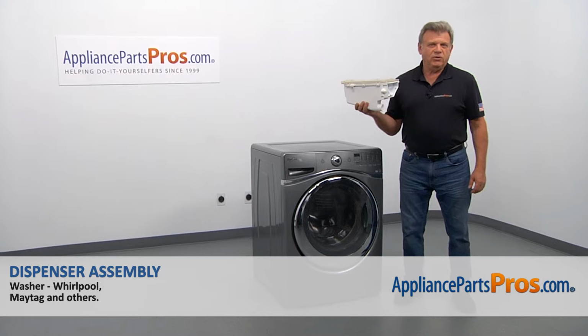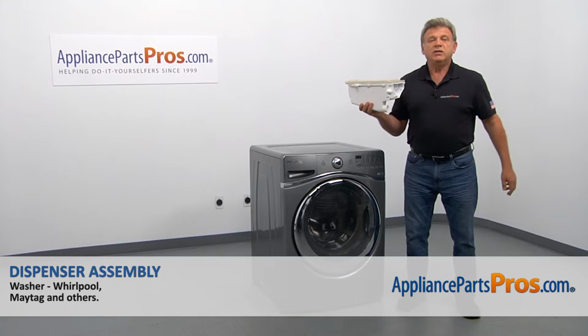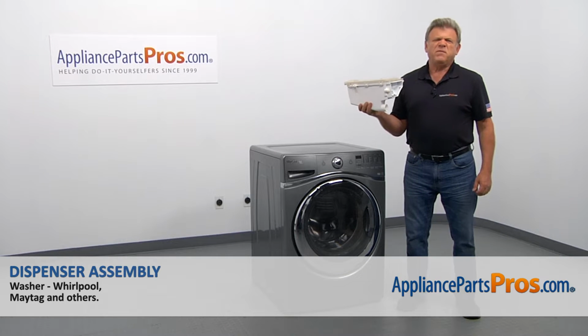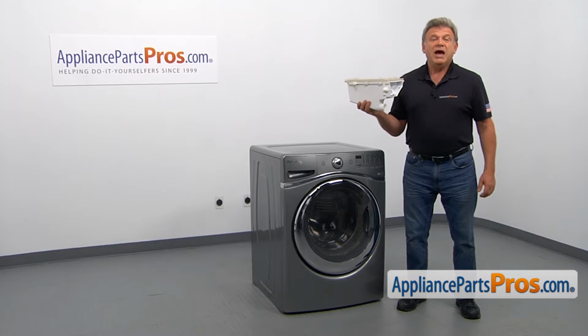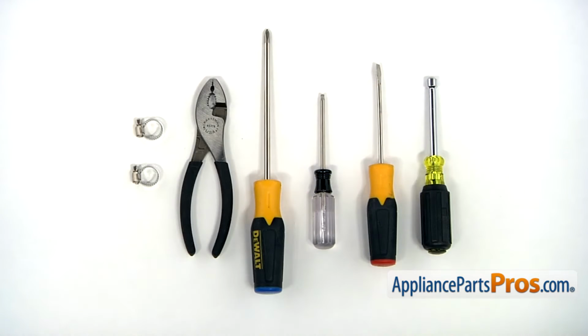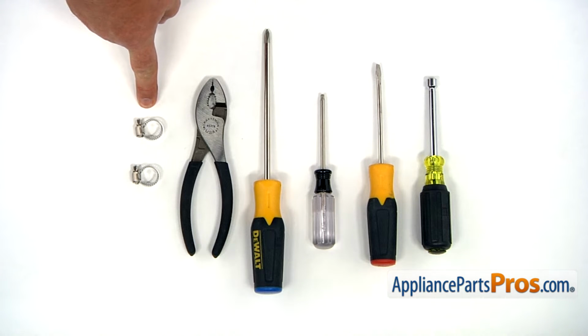In this video, we'll show you how to replace the dispenser assembly in a Whirlpool washer. It's going to be a very easy repair. Should only take a few minutes to show you how to do it. For this job, we're going to need a 1/4-inch nut driver, flat blade, Torx 20, and a Phillips screwdriver, a pair of pliers, and 2 hose clamps size 10 to 16 millimeter in diameter.